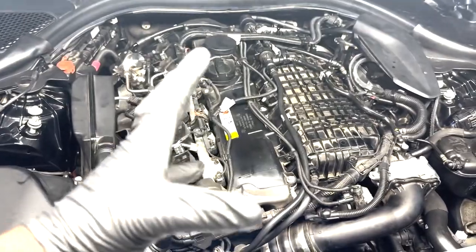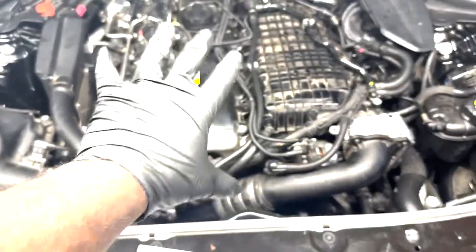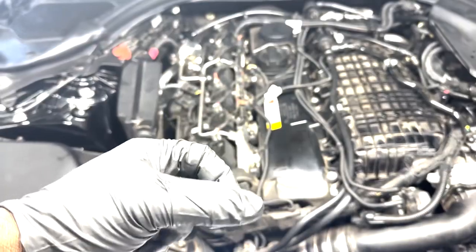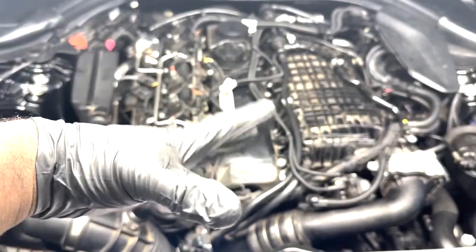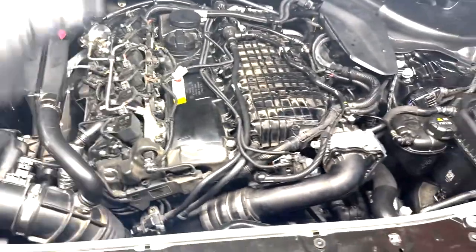And so now what we're gonna do, since I filled up the coolant and I filled up the oil, made sure I filled up the oil just to prove to myself, empty. I put some anti-friction compound inside of it, the Liqui Moly version, and we're about to connect the 10 millimeter on the back, on the battery, and after we connect it on the battery, then we're going to initiate the coolant bleed procedure. Feel free to pause it here.